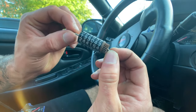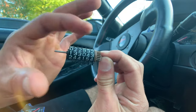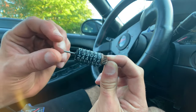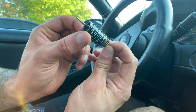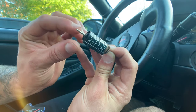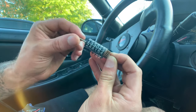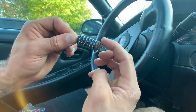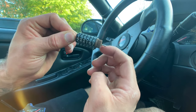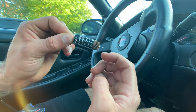So now we're left with the actual odometer. It's important to note that these black bars here are what rest on the bottom — so when it sits like this, these are the numbers that you see; this is the current reading. Also make note there's this little black ring here. The black plastic piece that we take off will slide back underneath on the bottom side of that. So as this wheel spins, it jumps this little thing — the little teeth on the gears — which cause it to read the miles.